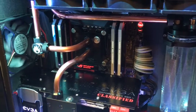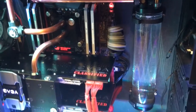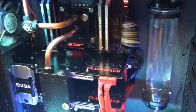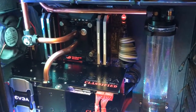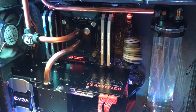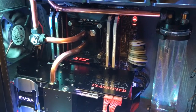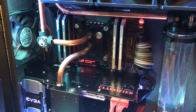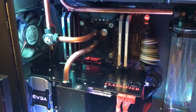When I was doing acrylic I went back to soft tubing because two of my tubes cracked. My case flexes a little bit and there are vibrations from the desk, so any pipe with a lot of tension will end up cracking over time. I'd rather spend more time gaming than worrying about whether my tubes will crack. Acrylic looks great for pictures, but copper is worth it if you're willing to put in the time, and the tubes can be painted any color you want.